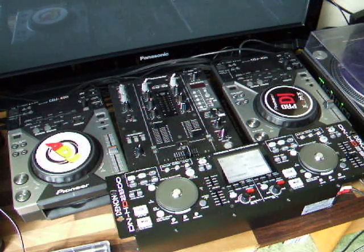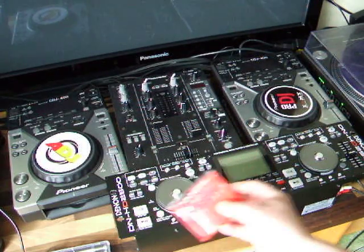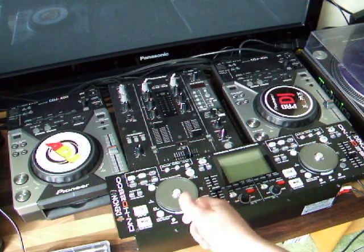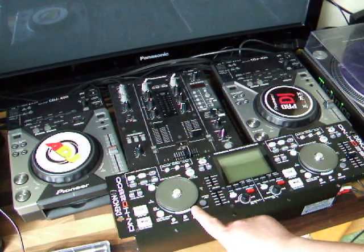I thought, what the heck — this thing's out of warranty, I've got nothing to lose. I normally work on laptops and Macs and things like that, so I'm quite confident with taking things apart. So I powered the unit off and had a look at the jog dials. I used a hex key — in this case it's a 1.3 size — and on here you'll find there's a small hex key socket, so take that off.